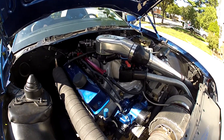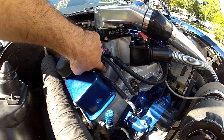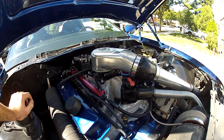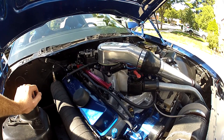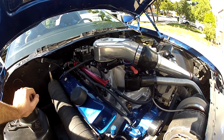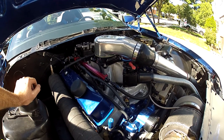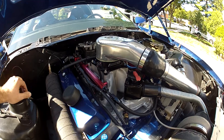Get yourself a fuel injector intake that has fuel injector bosses on it, or you can use a carburetor intake and have them welded and drilled out — but that's a process you gotta pay the machine shop for. This intake was decently priced, so I got this one. It's a Hurricane from Pro Comp, which is pretty much a Victor Senior that you can port out and make into whatever you want. It's ported to a 12-degree head because that's what the heads were. It's like a third of the price of an actual Victor Senior fuel injector intake, so it worked out pretty good.